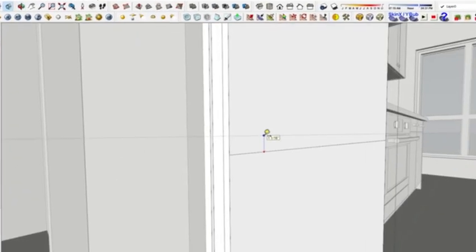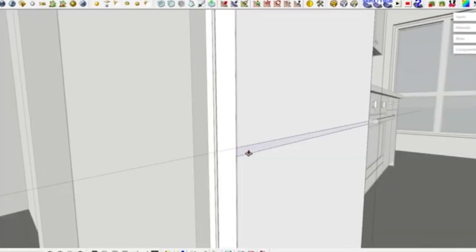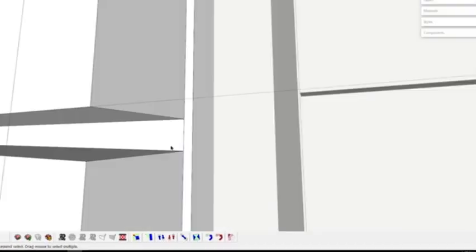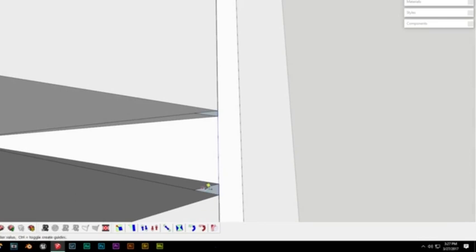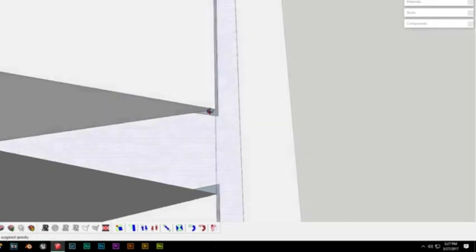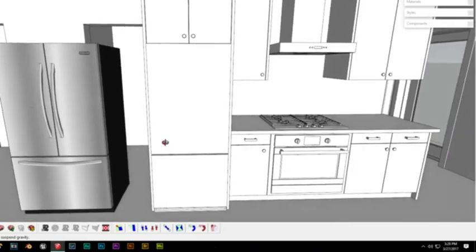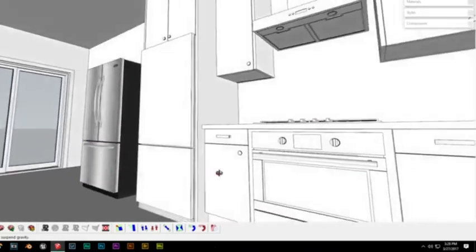And I guess we'll use about a 1/2 inch gap here between the door and the freezer. And then push that back to the stripping. And we can push that back to the body of the fridge. And then it went in 3/16, so we'll have this go down 3/16 and up 3/16. Alright, so we have that. And we can move on to doing the handles. I think that looks pretty good the way it's set up there now.